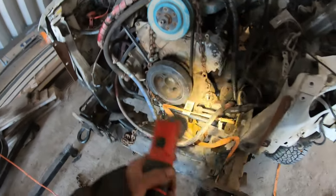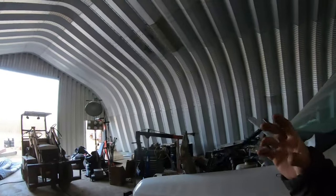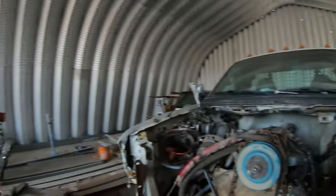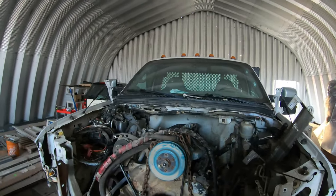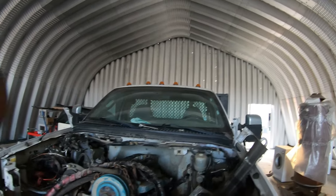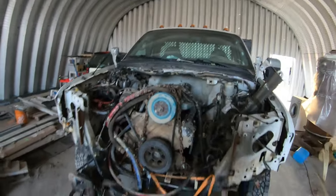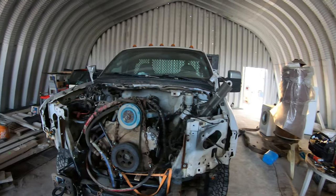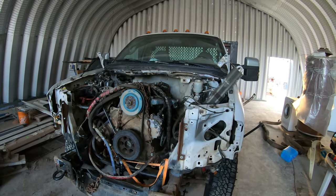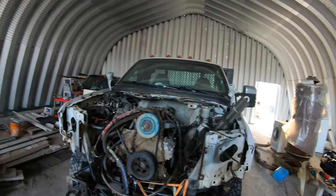So where I'm at: relocate the fuel filter, engine mounts, rear engine mount. Another thing — the gauges in the F350 are narrow and wide, and the gauges in the International are tall and just as wide, so they're not going to fit in the dash — they're just a little bit too big. I was thinking I'll just do all mechanical gauges, but you'd have to figure out speed and calibrate it. I was looking at those all-in-one gauges you can get for race cars — plug and play, you put a plate on the dash, mount the screen, and you can calibrate it really easily digitally. But I think I'm still gonna go with manual gauges. The all-in-one gauges are like $750 USD — here it's like a thousand dollars.